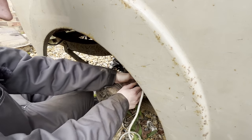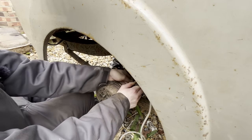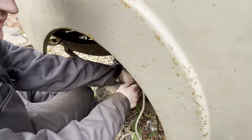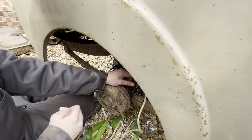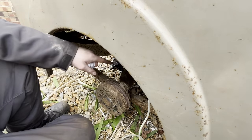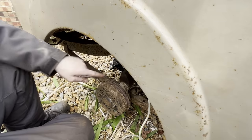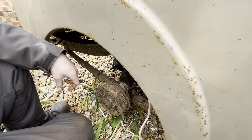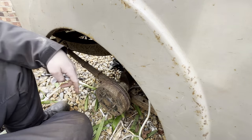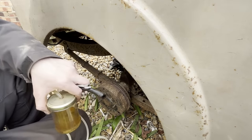What I should have said is we also filled the master cylinder up before we started and pumped it just on the ground. We didn't pre-prime the master cylinder or anything like that - we just left all the bleed nipples open, chucked some fluid in it and started pumping it around the system straight away. We had it spurting out of all four corners. But it's a beautifully basic system, so it doesn't take a lot to bleed.